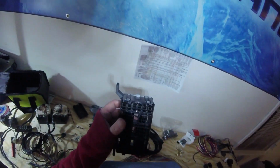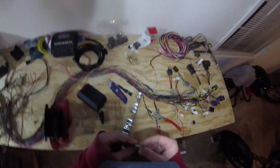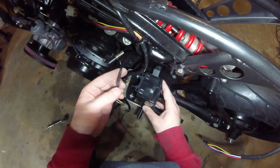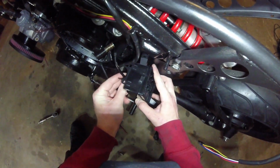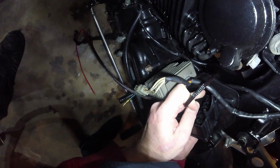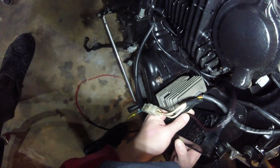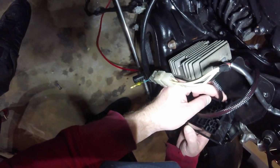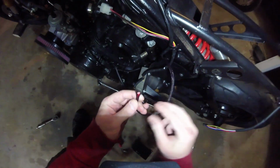So in terms of getting this done, we'll cut this wire to length and then go ahead and wire it up into the fuse box. So in terms of just getting the right length, again, this was the fuse box and it more or less mounted right about here. With this, we'll really just be feeding the wire down like so and directly over to the fuse. So I'd say something like that.